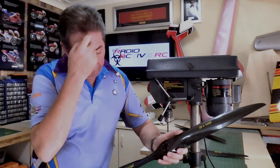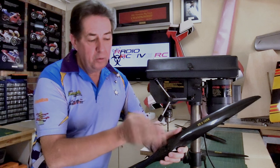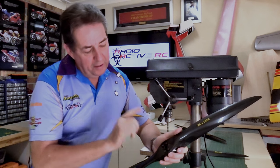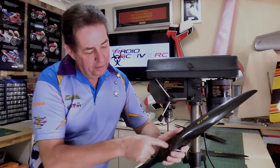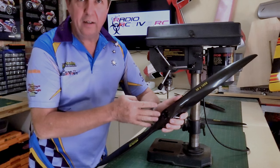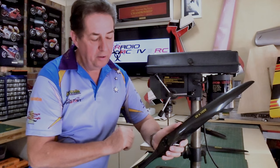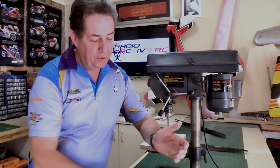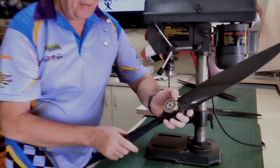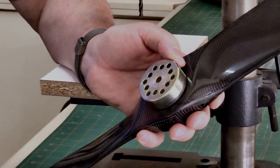Here we have a prop that's already been pre-drilled. I like to set my propellers up so that they come on compression at about one o'clock or 12:30, if you imagine the front of your engine like a clock face. So as I come up it comes on compression and I can flick through it. It's pretty easy to do with this one — the bolt holes here are just a bit vertical. These two holes here followed a straight line from tip to tip. If you do that you're always going to hit between the one o'clock and 12:30 mark. If you go slightly off, you've got a little bit of room. So when you set up the drill jig in the back of your hub, we're using the inner holes here because I'm drilling this for a DA120, and I'm going to line up this hole and this hole on a vertical line through the prop.